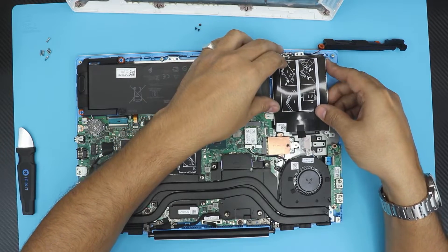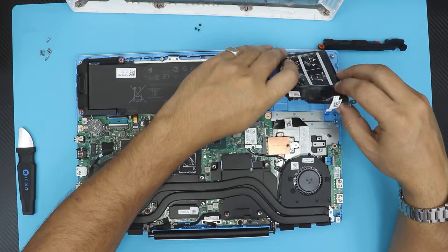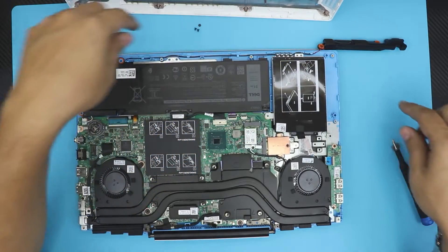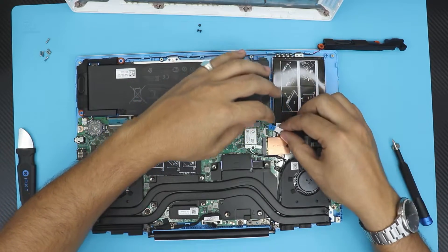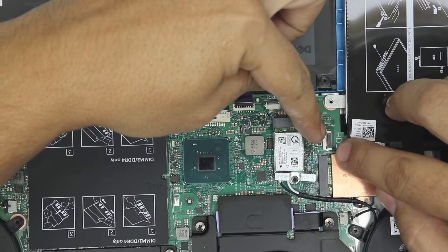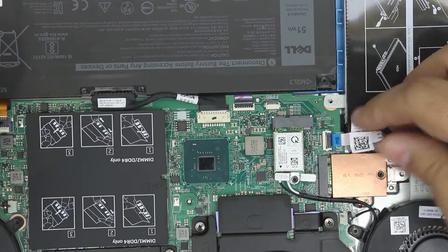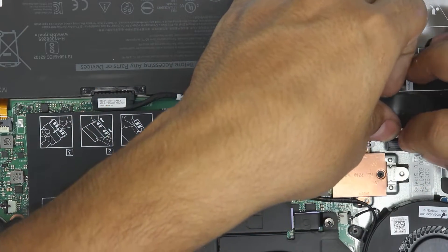Once you have it in place, place it in here. You can go ahead and put the three screws to hold it in place. This adapter cable has to go over, and the ribbon cable — the blue side has to face up. Lift up this hinge right here, take the black side, and shove this ribbon cable all the way in evenly, then close it. You can leave it just like that or do some cable management.